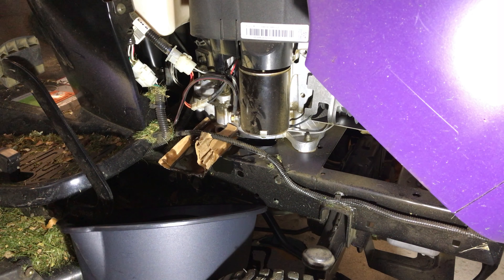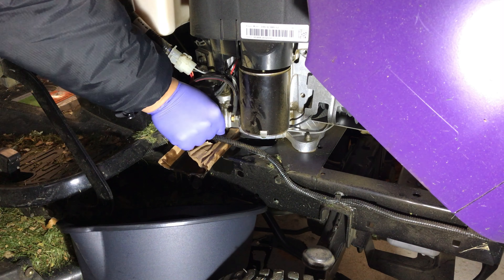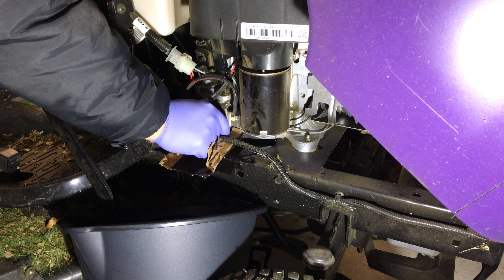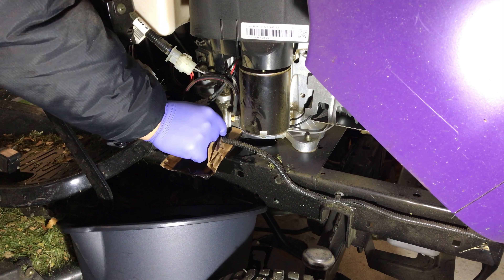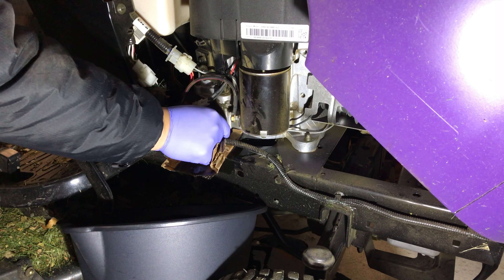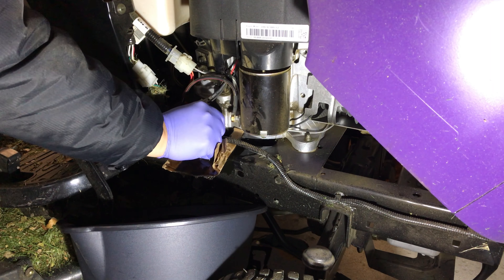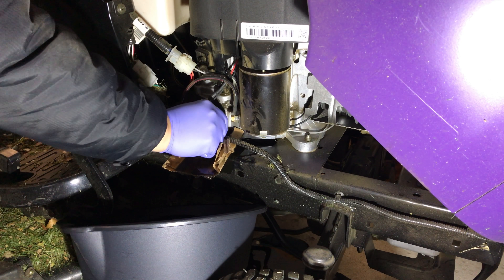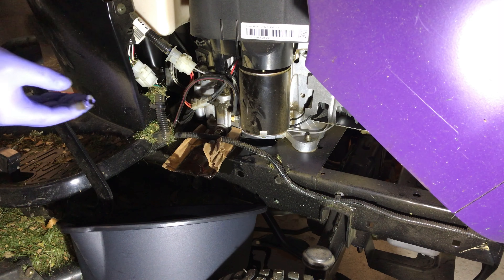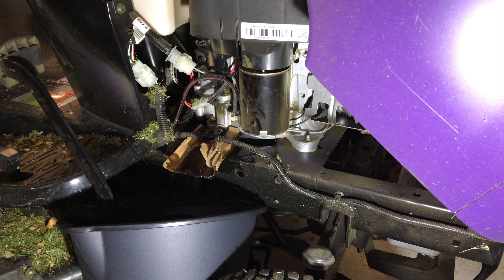It seems like the oil has stopped flowing for the most part, so now you just take your oil plug and thread it back in. I've created a little bit of spillage because I don't have the original trough, but you can just clean that up with a rag and then maybe use a little brake cleaner to get it dissolved. The other top tip is that once you release the oil plug, you want to unscrew or at least open up the oil cap on top of the motor to let air in — that will really increase the flow. I usually like uncapping it after I've released the bolt so I don't get it all shooting out, but you can do that as soon as it's done.